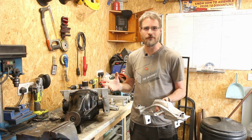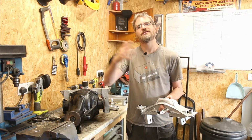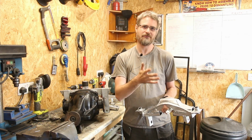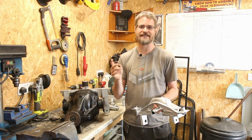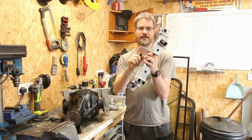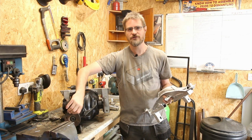and I'd run out of resolution at about 50-60 miles an hour. I want to be able to get up to the top speed of the car, which is going to be 100 plus, without running out of resolution and getting a good decent number of pulses. So I have fitted back the bracket for the original speed sensor that picks up on the 4 bolts that hold the prop to the diff.